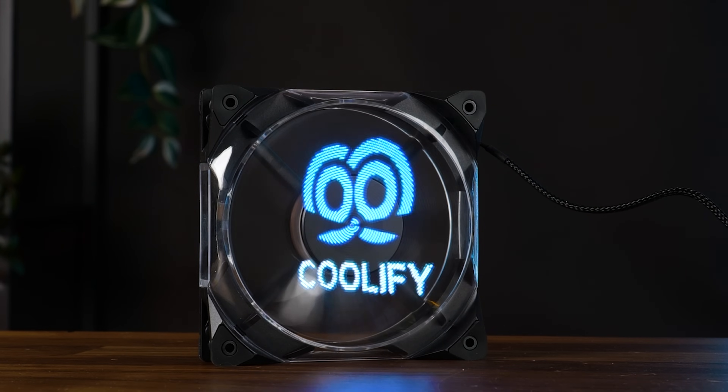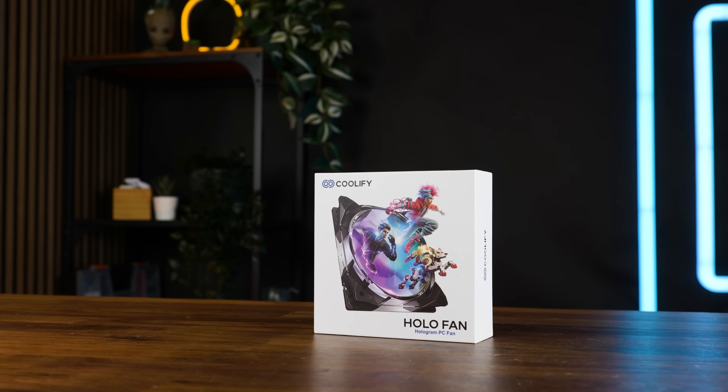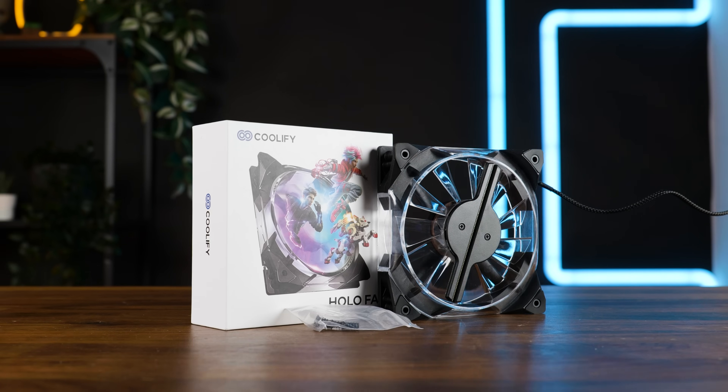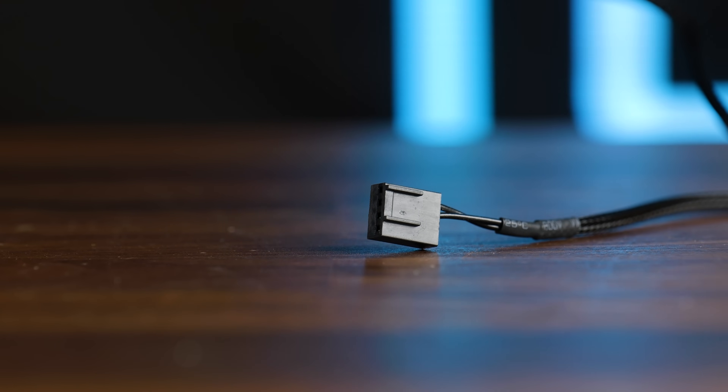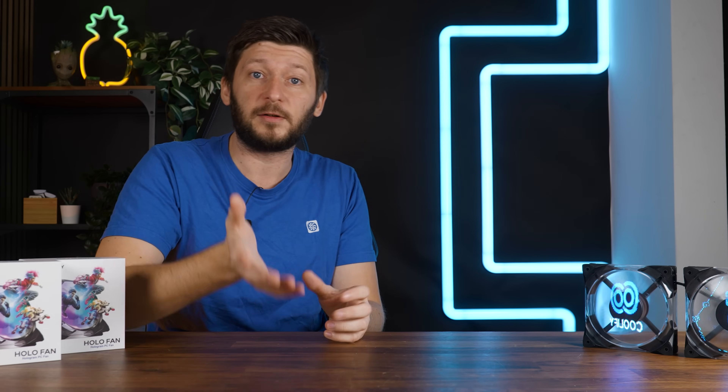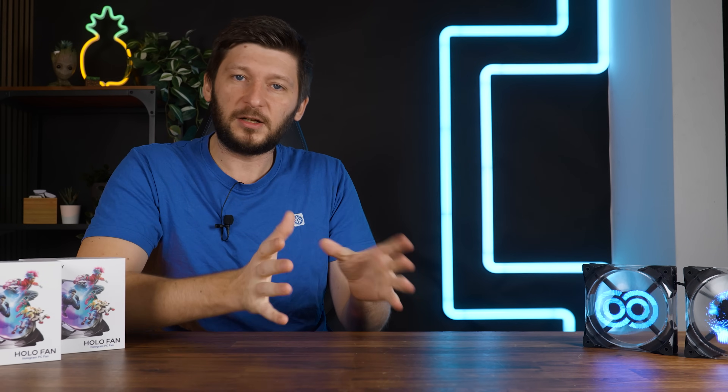The size of the image is about 4 inches or 100 millimeters, and believe it or not there is no proprietary cabling involved. The fan comes in a standard-looking box with nothing but the fan and a bag of screws. To power the fan we got a 4-pin PWM plug where only two wires are used — the 12V and ground. This means there is no feedback, tacho loop, or signal whatsoever, so you won't really know what is going on. These types of 2-pin fans are mostly used as an integrated part of something else, like PSUs or sometimes GPU fans — it's just a 3-pin voltage-controlled fan where the tacho line is missing.